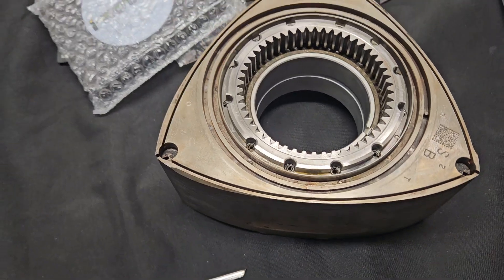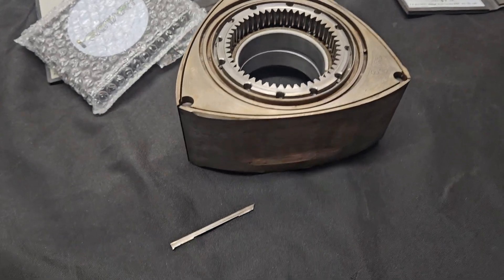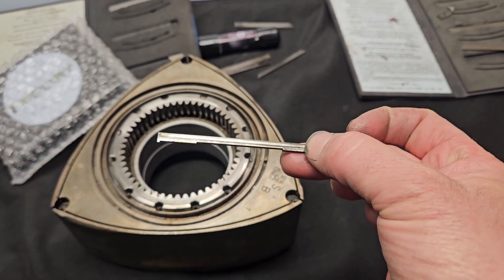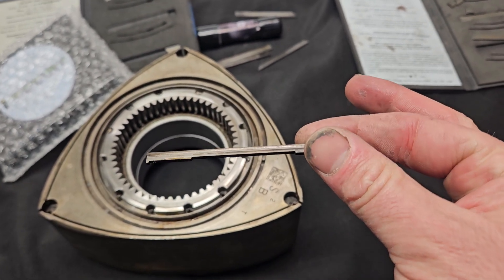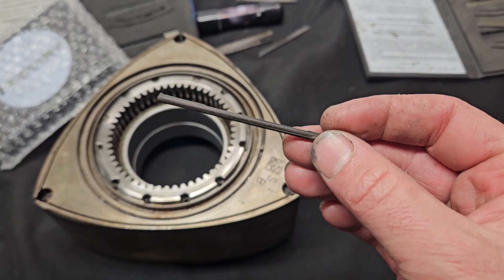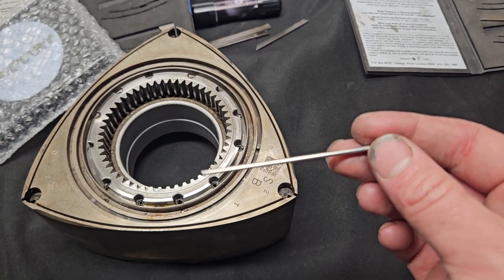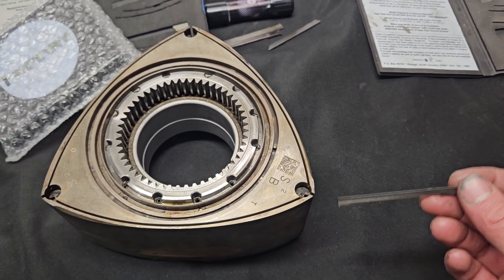So when you're doing a rebuild and you're building an OEM RX-8, restoring an RX-8, bringing it close to OEM trim back to life, I 100% recommend the OEM Mazda Apex Seal. It's a two-piece design, and in a naturally aspirated configuration — street-driven, light performance, some mild track days — it's going to be your best choice for reliability, overall total mileage, and component wear protection. The OEM Apex Seal in OEM trim has some of the better wear characteristics, whereas some of your aftermarket seals are a little more aggressive on wear. So if you're looking for reliability, mileage, and just a good brapping time, rebuild your Renesis motor with quality OEM parts.